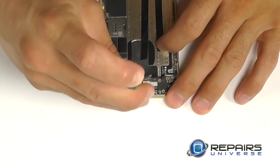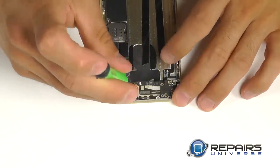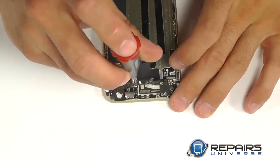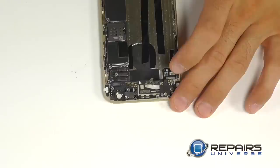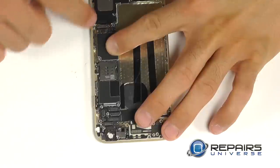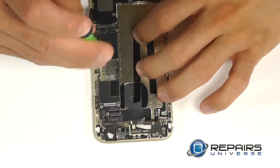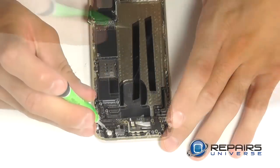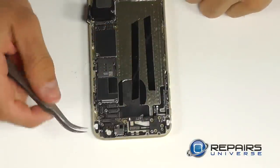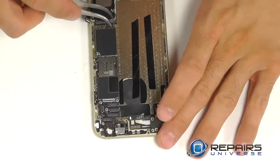Let's work towards removing our motherboard now. We have two Phillips screws up near the rear-facing camera. We have a standoff in the middle of the motherboard that we want to remove using a flat-tip screwdriver. We have a wafer plug near the bottom of the motherboard for the dock port connector, and right next to it is a coaxial connection that we need to peel up. A Phillips screw near the SIM card tray and one final Phillips screw near the rear-facing camera — with that screw removal there is an additional small strap we need to keep track of, similar to the grounding strap we took off earlier. With everything removed, we can carefully maneuver the motherboard out of the iPhone.